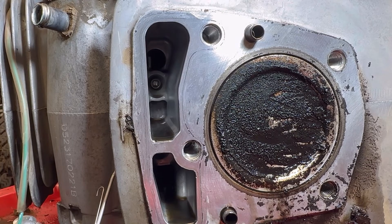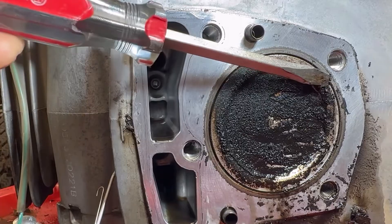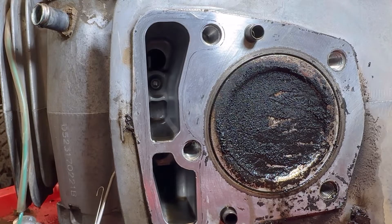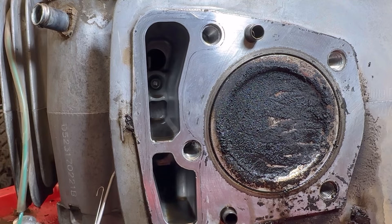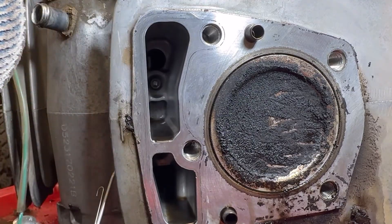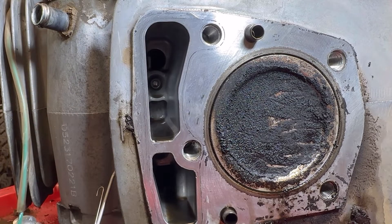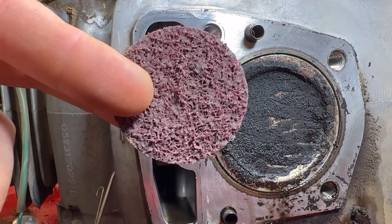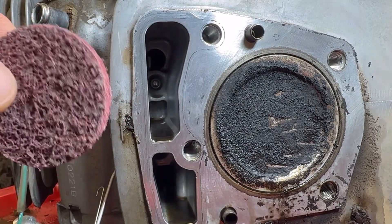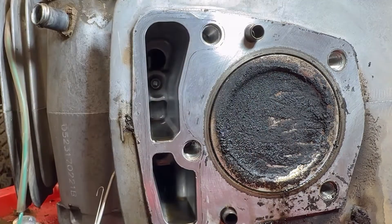To actually clean it, using a screwdriver to take off the big chunks is okay — just don't dig in there, you don't want to scratch the surface of the piston. Then I'm going to use a wire brush, because that won't get any chunks or metal shards into the engine. A couple of things you should not use: don't use sandpaper, don't use any sanding discs. Also don't use flapper discs, emery cloth, or 3M red-type stuff, because there's aluminum oxide built into those discs and you don't want any of that dust getting past that piston ring.